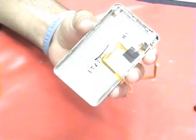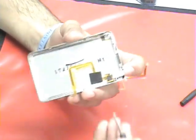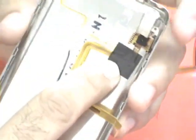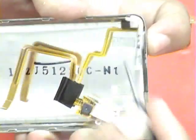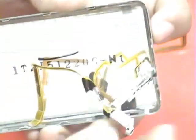There's also some adhesive holding this in the back plate, and we need to consider that so we won't rip the cables in case we need to use this headphone jack. We just pop this up. There's a tape here that we need to be careful with not to rip the cable. And then we take this part out and just pop it out like that.